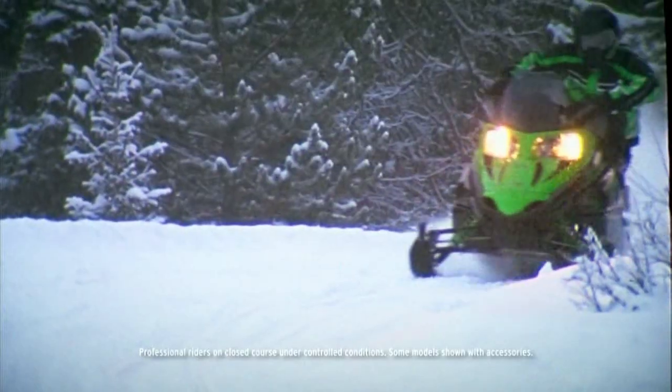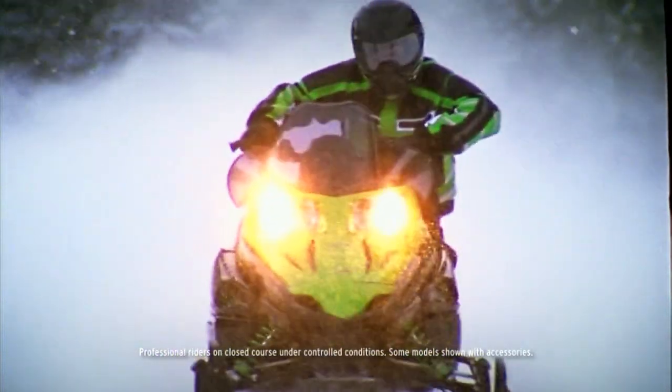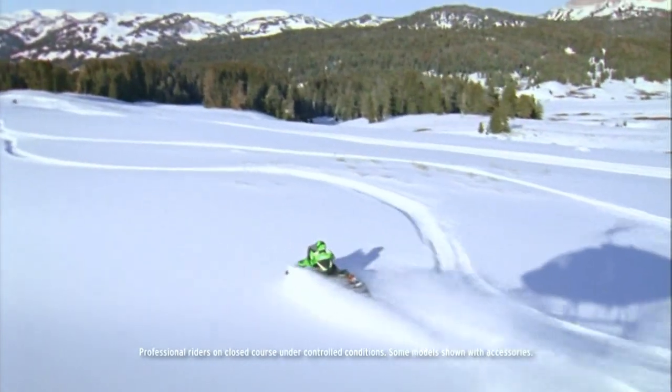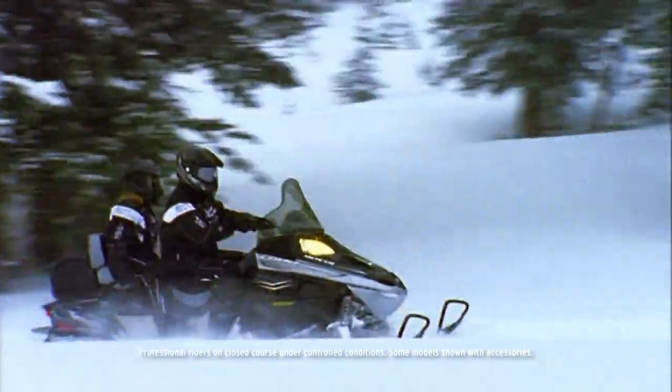Initially, we had a 360 dual balance shaft and a 180 crankshaft. The pistons were opposite, like a two-stroke with a single balance shaft. And we had to decide which was better for the customer. Through extensive testing, we built engines, we built snowmobiles, and we rode them in the mountains and on the trail. We decided that the 360 ultimately would deliver the most power and be the smoothest engine to satisfy both the performance segment and the touring segment.